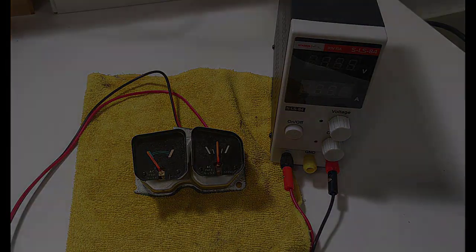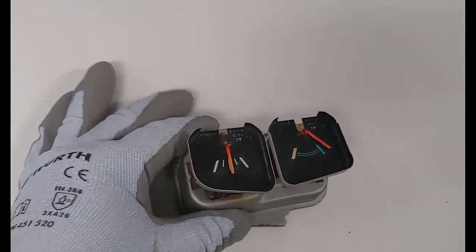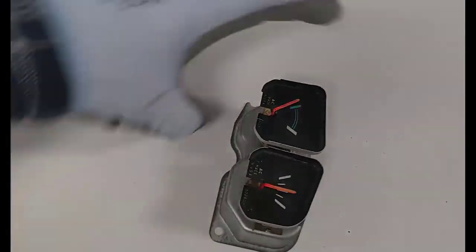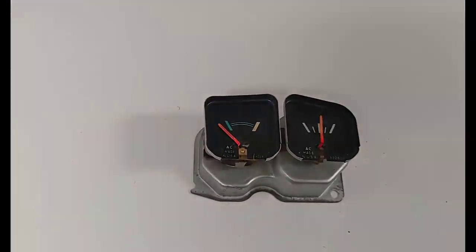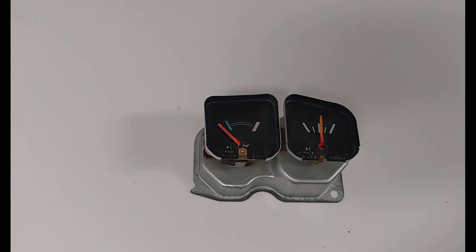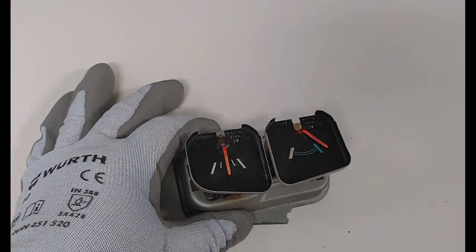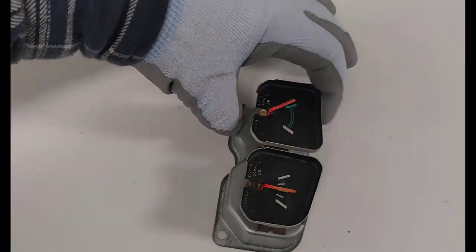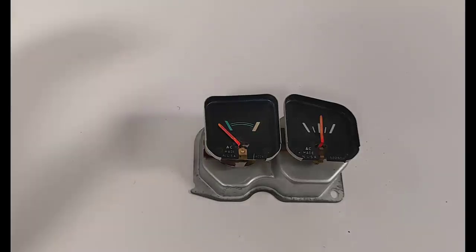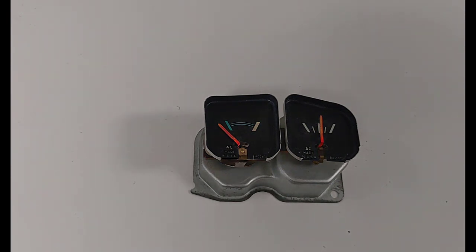So, the reason for this study was to find out what an old GM ammeter is all about. On the internet you see comments like, GM ammeter is safe because it is an external shunt ammeter and the work current never enters the cabin. Partly true, mostly true, but it is not just a sensitive voltmeter sniffing the charge wire. Measuring the charge current is a bit yesterday's news, more related to the old DC dynamos. A voltage reading would be a much better way for alternator diagnostics.